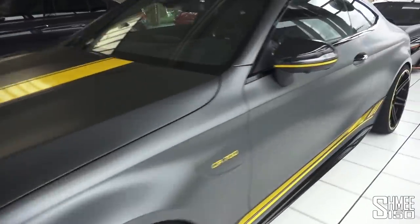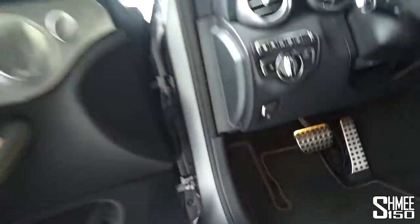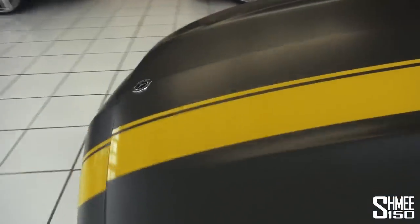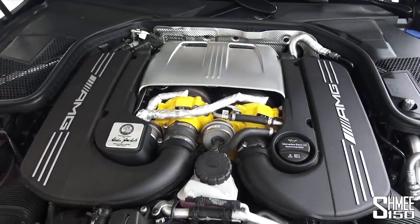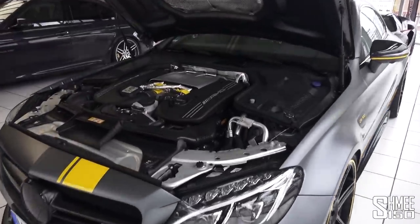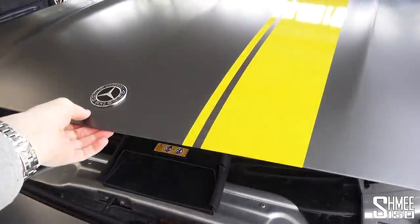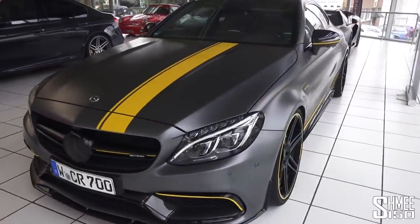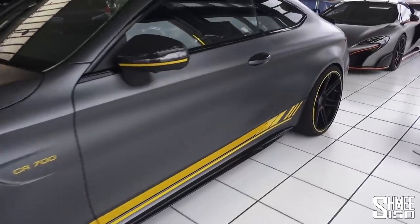Let me pop open the bonnet so you can see what has been done to make this possible. New turbos — painted yellow, which looks nice with the highlights — a new intercooler, the car sitting on new springs, new wheels, and catless downpipes. Basically all of that comes together to make a little bit of a monster. This car is kind of marking the start of new things for Manhart — moving on, working with different brands, growing out instead of just necessarily working with BMW, looking into Mercedes projects as well, and opening the door for more in the future.